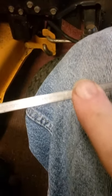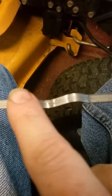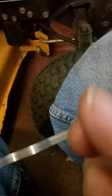We're going to do the final check after we run it. If you need to add some oil, consult your owner's manual and see how much it's supposed to have. Right up here is your full mark. A little bit above the line right there won't hurt it, but you don't want it way up high. I've seen customers with oil way up on their dipstick thinking they had too much — come to find out the carburetor was flooding so bad it was putting gasoline in the oil. You can check that by wiping your finger on the dipstick and smelling it — if it smells like gasoline, that's a different problem.